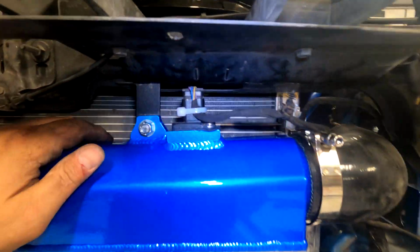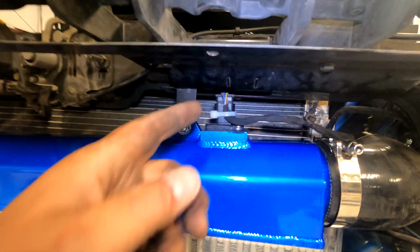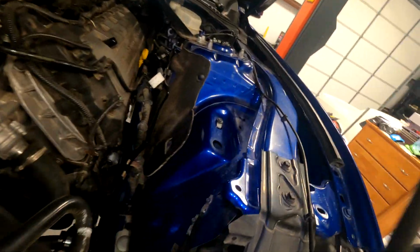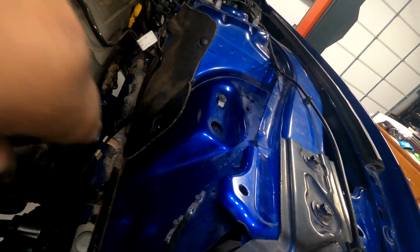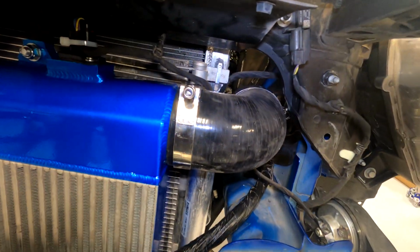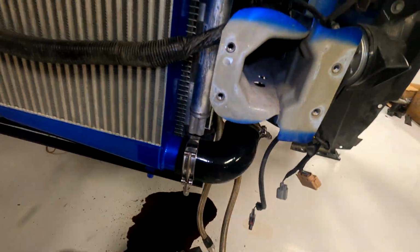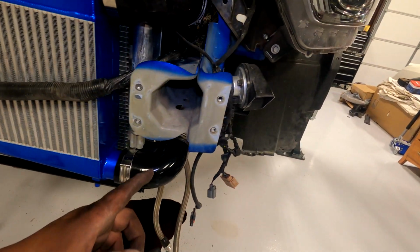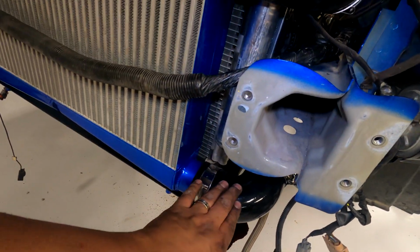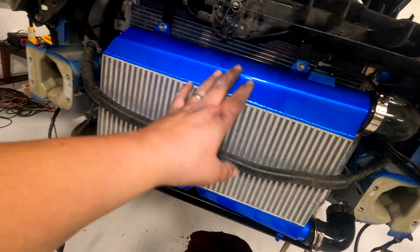So then that's in. You got to plug the MAF in before you push this in, because, well, at least on mine, because I have this oil cooler bracket, it'll hit. I had to unclip the whole MAF wiring from there. Take the 90 elbow, the bigger one, I think it's 3" or so. Just put it on loosely here, put the two 90s loosely down there, and we're gonna leave that until we put the intercooler pipe, mount that, and that mounts to this on both sides. So then that'll get this piece all here completed.